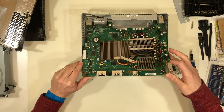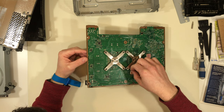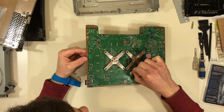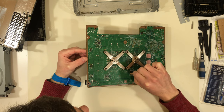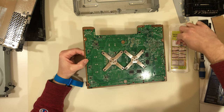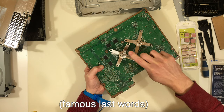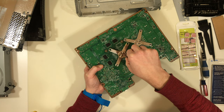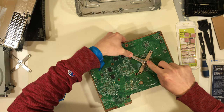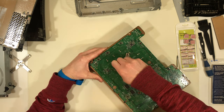After removing the rest of the screws, the mainboard can be removed. If your model has RAM chips on the bottom side of the board, carefully remove and save the thermal pads — they can temporarily be stuck to a piece of plastic or wax paper for safekeeping. There is an X-clamp removal tool available; however, I'm just using care and a flathead screwdriver. I'm placing my finger in front of the screwdriver just in case I slip — my finger will help protect the board. Usually, after two sides of the X-clamp are unclipped, it can be wiggled off.